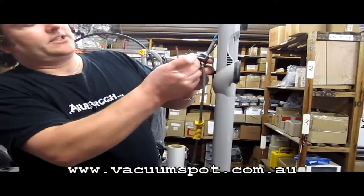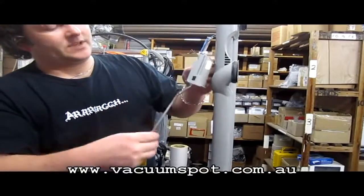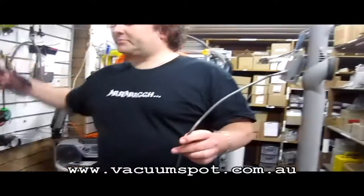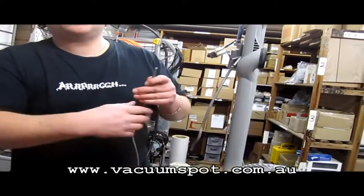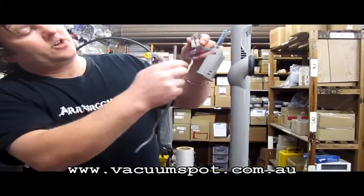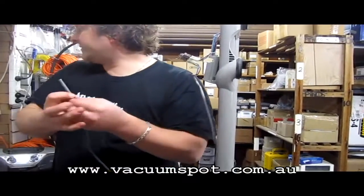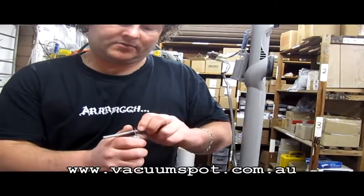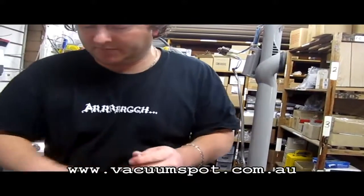Okay, and we can actually release that cord there. Alright, so what I'm going to do now, I tend to leave those on and grab some cutters and take about a foot off that length. Now I just have a look here. It's pretty easy as a guide because you've got about 1.5 inches there, so I just measure it up about the same. Now very gently run around that with a Stanley knife. You just want to get rid of this plastic sheath.